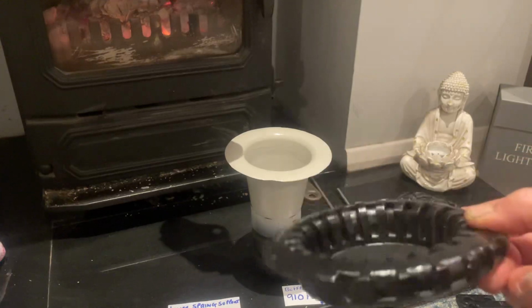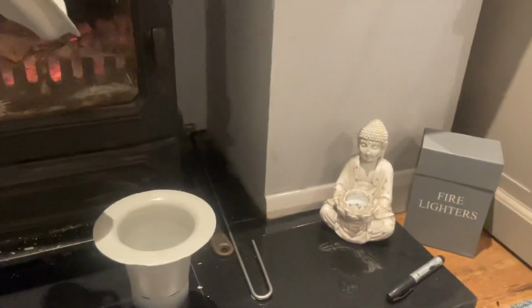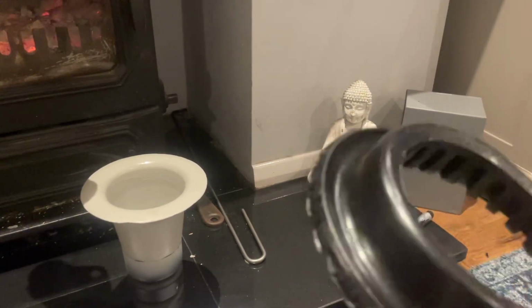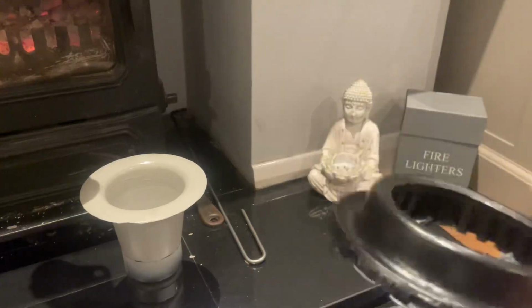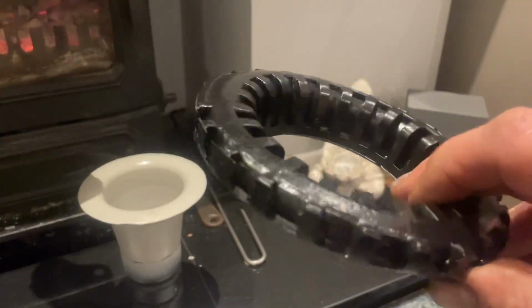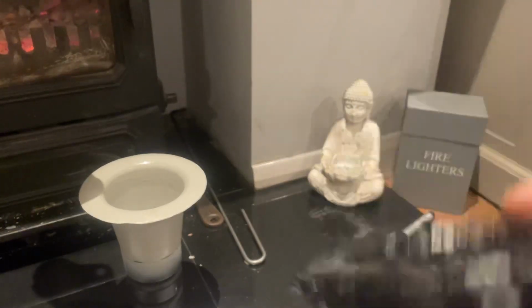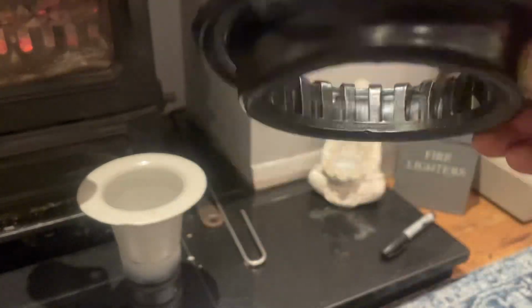This is the rubber support. This is the upper support that sits in the top of the spring there before it bolts to the well. It doesn't bolt actually, it's just under compression. So again, I think that's an obsolete part. I may be wrong. You might be able to get these in Europe, but it's not in bad condition. I've just given it a quick spray over with some satin black, but the actual rubber isn't perished. So that's going to go back on.